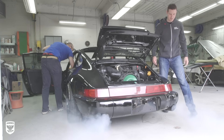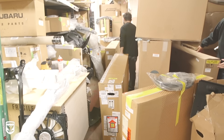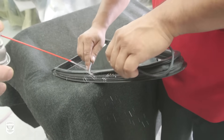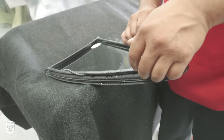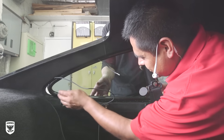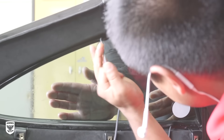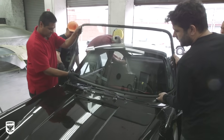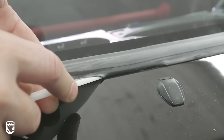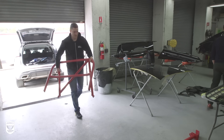Next it was time to install the new windshield and glass. A cool trick was used that I'd never seen before: a string was added to the rubber gaskets along with a lubricant to help open the rubber and attach it to the frame of the car. Without this trick I'm not sure how you would secure the gasket from one side to the other. The same technique was used on the windshield as well. Then a plastic stick carefully pulled the rubber up from the front side onto the frame to keep water and dirt from entering behind the glass.